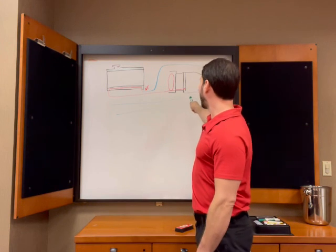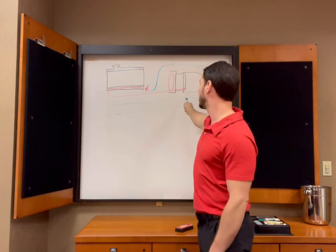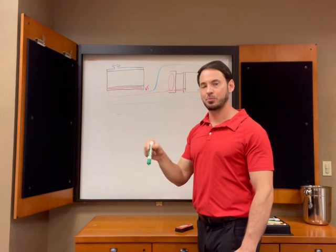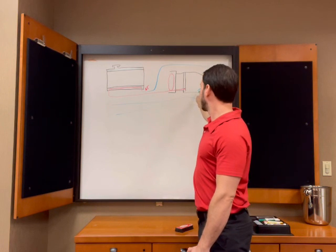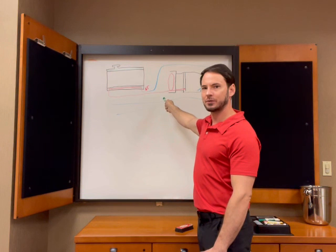So if we have fluid below 150 degrees, or something like that, right in there, then the first thing the TCU is going to do is reduce that fluid pressure even more. So basically we're making a bad situation worse. So no, I never want this fluid below 150.